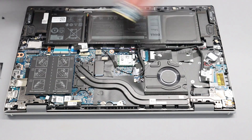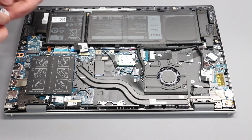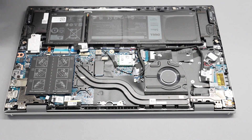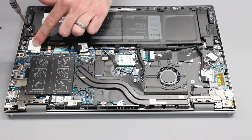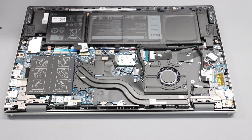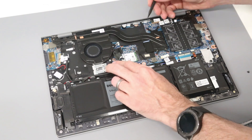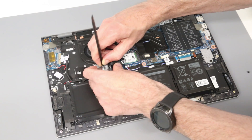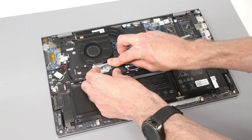So we are going to move that drive over here and refit with the cover over the top of it. To do that, we have inserted it in, press down, and screw in the screw. To add an M.2 2280 drive, we are going to peel back this cover, and we can see we have this little mounting bracket here. We are going to insert the end of our pry tool and, if we can, just slide it out.